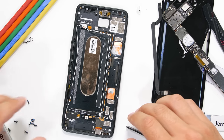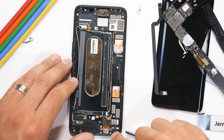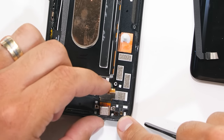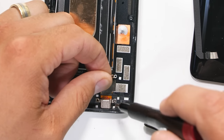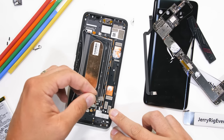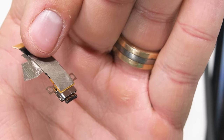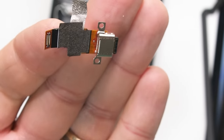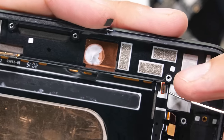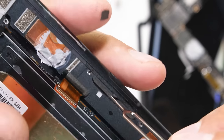Now that the battery is out, we get to see another large secret the ROG has been hiding — there is an extreme amount of copper in here, spilling out from behind the battery all the way to the edge of the phone. I normally like to reassemble phones after a teardown, but this vapor chamber is worth a look, which means we'll have to sacrifice the screen. I'll take out the tiny charging port first, which does not have a rubber ring around the tip, so maybe the phone is not as water resistant as we thought. Interestingly, each of the four microphones do have cute little water screens over the inside shaft openings — four microphones surrounding the sides for noise cancelling.